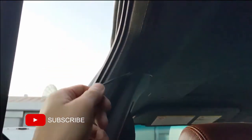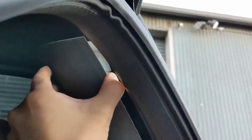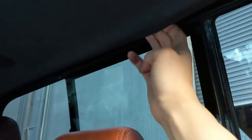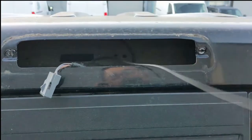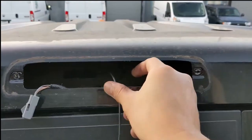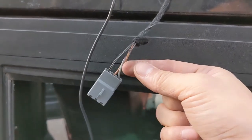If you're enjoying this video so far and you think it's helpful, please like and subscribe. To get your camera wires to the third brake light, you'll want to pull away the headliner. This should give you enough room to reach up and pass the wires through an opening that already exists. Once you've passed enough wire through, go to the bed of the truck, remove the third brake light, and you should be able to feel that wire bundle you passed through. Go ahead and pull the third brake light harness and the camera wiring bundle through.